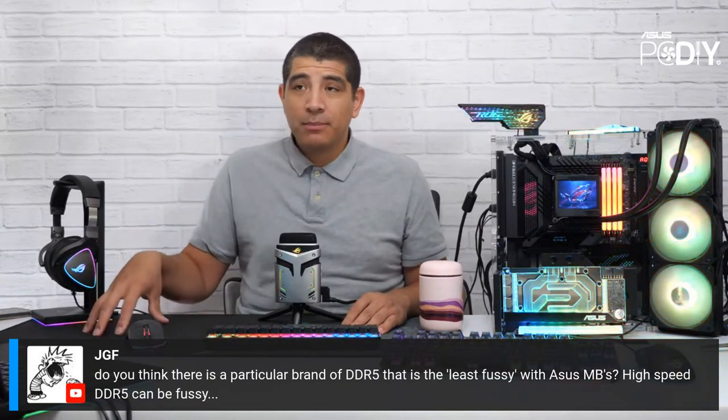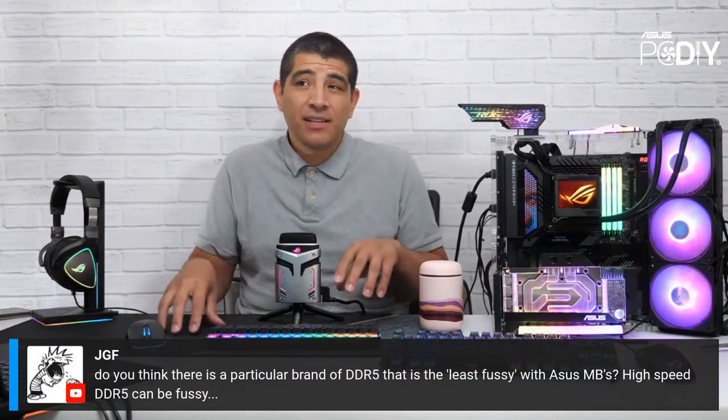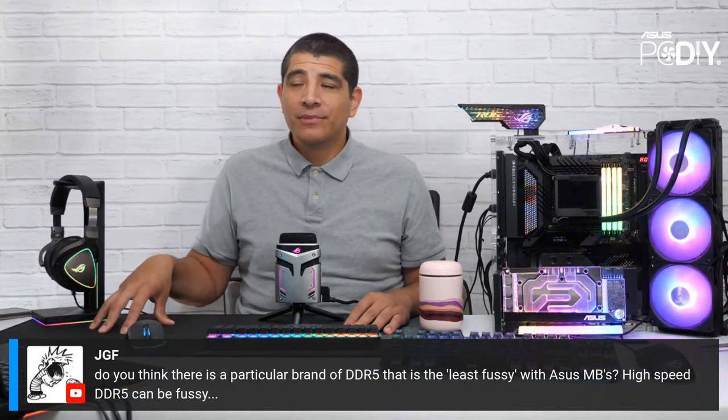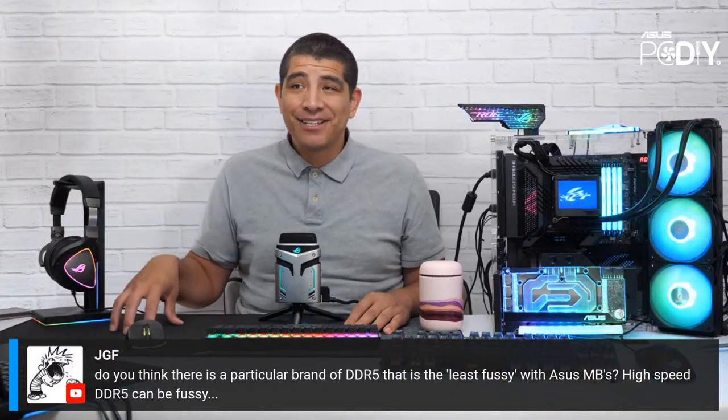Because you could have maybe one or two of those CPUs, like I talked about, or maybe even three, right? Because if it's 70, 80%, it could be up to three CPUs that don't even want to run a 6,000 MT memory divider. The motherboard, the UEFI, the RAM doesn't have anything to do with that. It's all the memory controller.